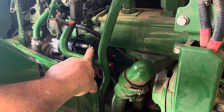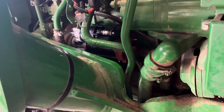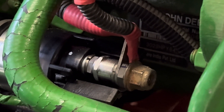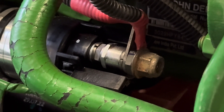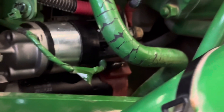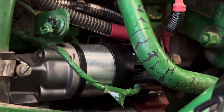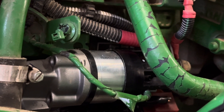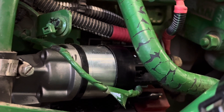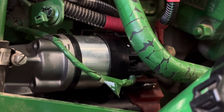It's just a matter of getting her all wired up now. Reach in there, back that nut off — it should be easy. And then there's a small wire that engages, tells the solenoid to engage. Button up all the wiring harness to your starter. You've got two wires that go under that bolt right there. I fabricated it a little different than the way it came off, but it'll work. And then you've got that little green wire — goes onto a stud just to the right of where that green wire ends. That takes an 8mm socket. Best way to do it is start it with a shallow socket then swap over to a deep one because you don't have much room. That long-threaded sucker with fine threads seems like it takes about 40 turns to finally sink in there, but once it does, it's there.